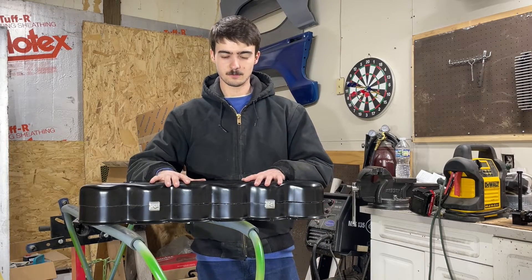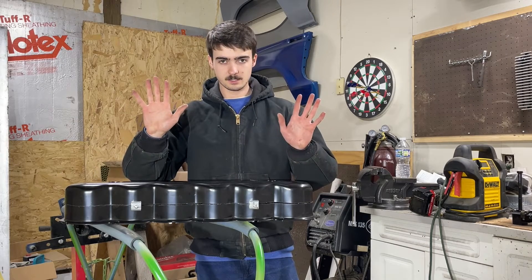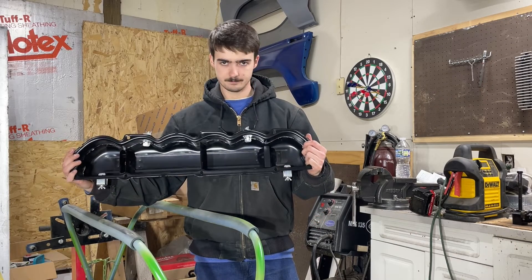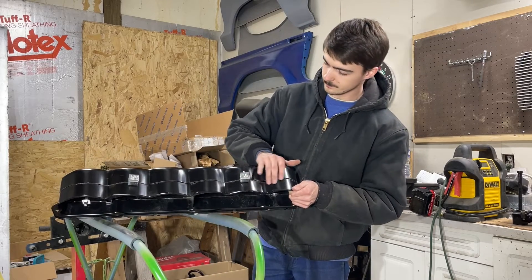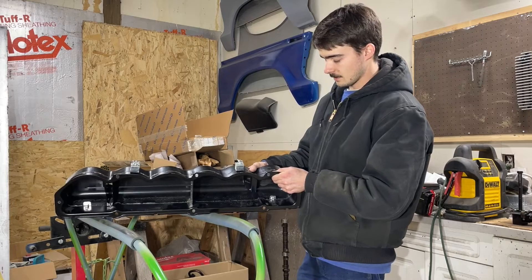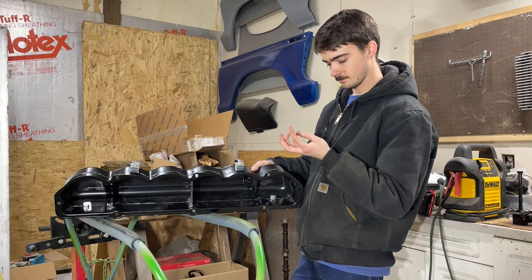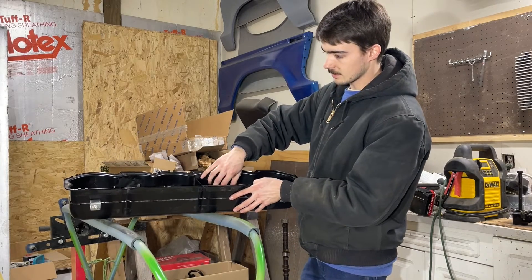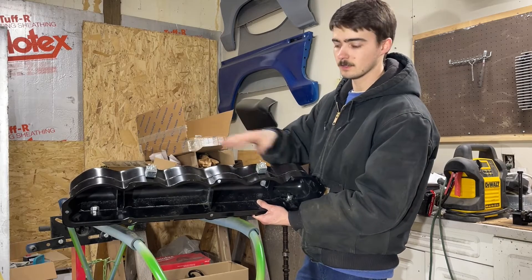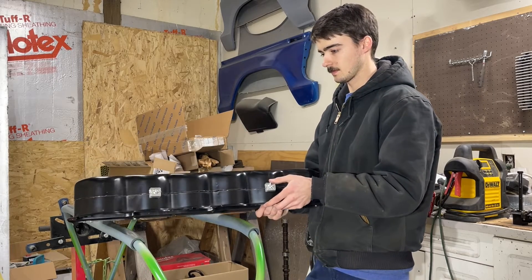Now I know what you fellers are thinking — goodness gracious, that thing's ugly. Well... yeah. Hang on just a second, let your peeper soak it in. I think it's going to grow on you. Probably not. I think once I get it cleaned up, get it welded, smoothed out, no one will even know I did anything to it. Anyways, I got a lot of cleaning up and sanding and welding. I'm bleeding. So I got to get this cleaned up in here, get all these burrs off, and then weld it until it's all one piece, and then grind it until it's smooth again. And then I'll have one valve cover.